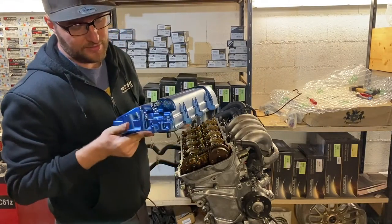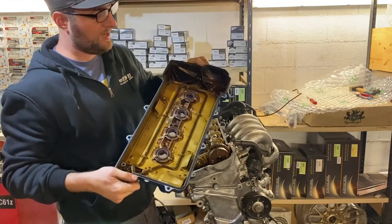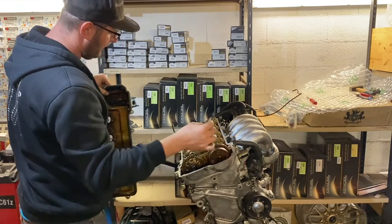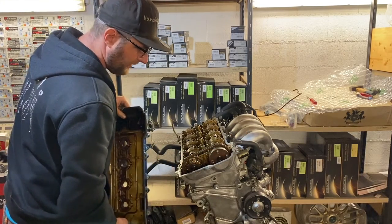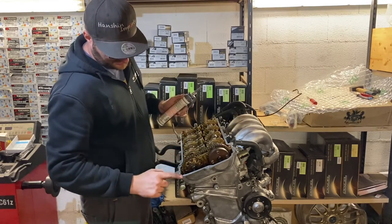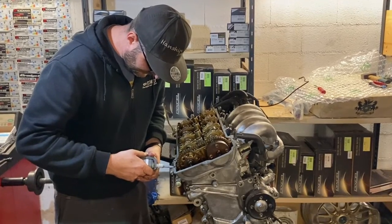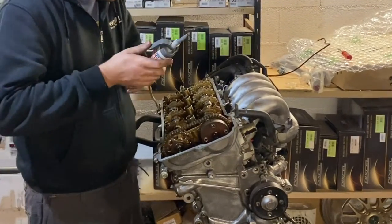Let's get all the screws. As you can see, I painted my valve cover in blue. What's important when reinstalling this is putting a brand new gasket, which is what I did — brand new gaskets all around, and these four were also brand new. We also have a brand new gasket for this little tube here. I still need to add a tiny bit of sealant right here because there's a gap between the head and the timing chain cover coming in, so it's important to add some paste here to make sure we have a decent seal.